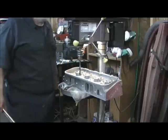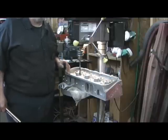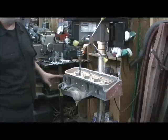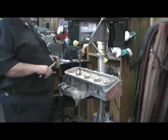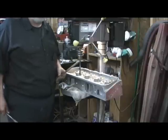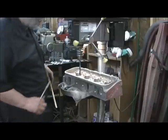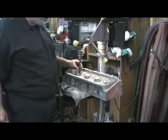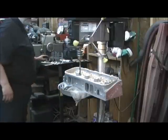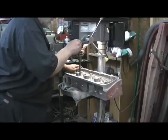However, when you talk about studs, the inside wall diameter might ought to be a little bit bigger because the stud's body is thicker. I know that this is going to get studs — not many people run a 632 that don't. So I've got to make sure there's some wiggle room, so I go to a little bit bigger tube diameter. This is a brass tube and it's fine — it's going on the intake side. First I use a core drill to take the bolt material out, then I come back and chase it with a reamer.